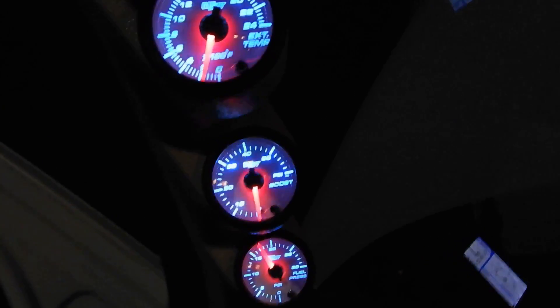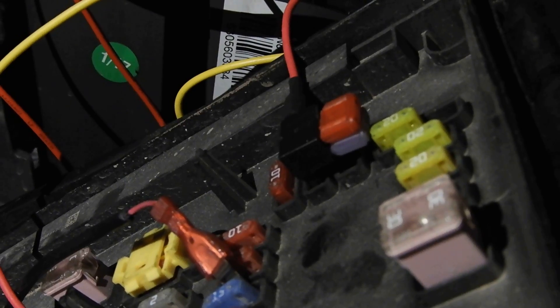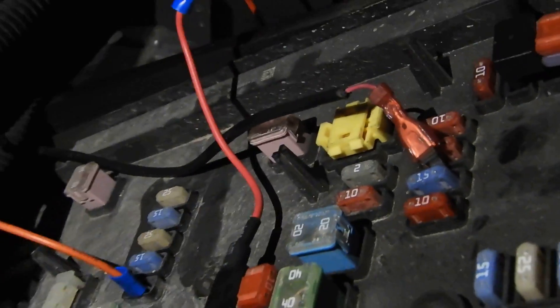Glow Shift gauges are done! Just wanted to show you real quick what I was talking about with the fuses. In the fuse chunk there are two fuses — the red 10-amp that was already there, and then there's a pink/purple one underneath it that I did not have in there. If you use these circuit expander fuse chips, you've got to put that in there or it's not going to work. I learned that the hard way — should have read those instructions fully.